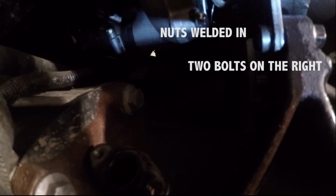I put these on so it would hold the turbo back. Right, there's two bolts. There's one there, one further back. They're the two that hold the turbo on. There are no bolts at the top like it suggests in the manual. There's just them two, and then the clamp holds the top. Where I've just showed you the clamp, the banjo clamp, the exhaust. So there are no other bolts that hold that on, except for these two.